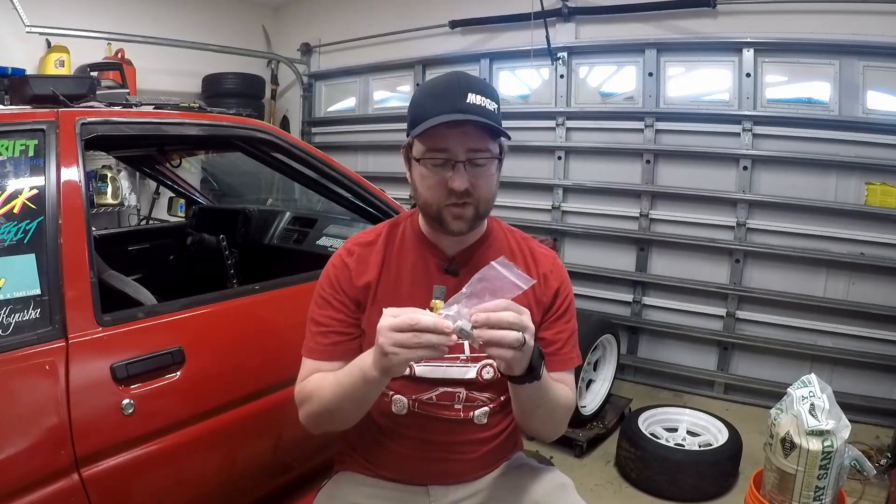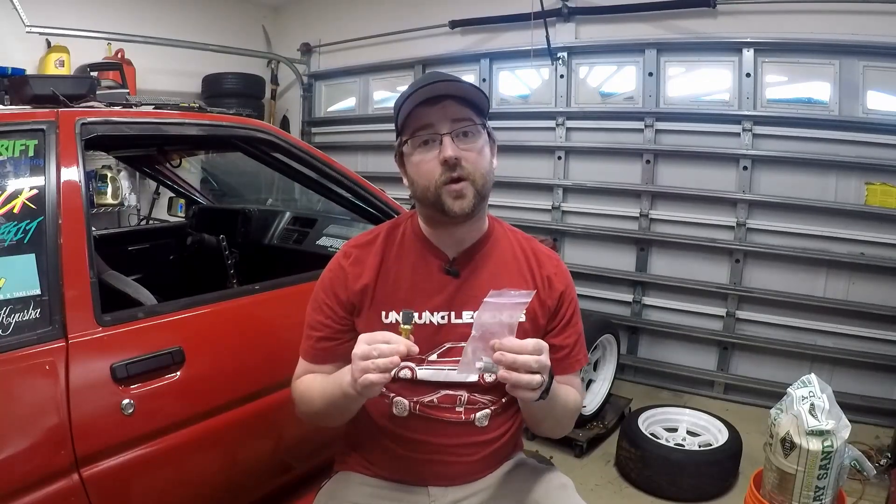I've been told this is the same sensor that comes out of a Toyota Echo, like a 2001 — it comes in pretty much any of the 1NZ engine vehicles, including a Prius. The kit from PanicMade comes with a new connector, new terminals, and little weatherproof seals so you can wire it in. The only thing you have to do is run one new wire for the gauge and have that in your harness. As long as you know how to crimp pins on, that's all you really have to do.